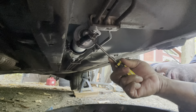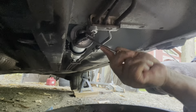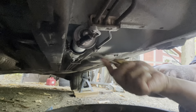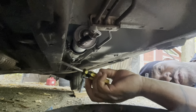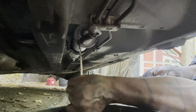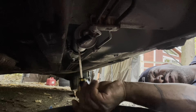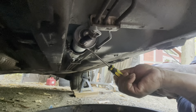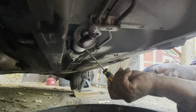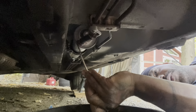When you're doing this job, make sure you've got the fuel relay out. Basically I've got the battery disconnected, so I'm not gonna worry about it too much. The battery is not on. Make sure you at least take off the ground wire anytime you mess with the fuel system — take the ground wire off and go from there.